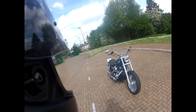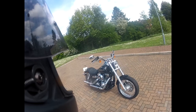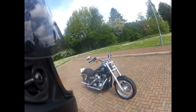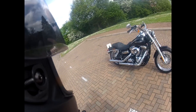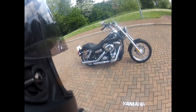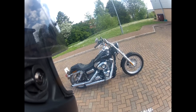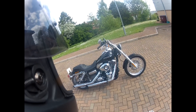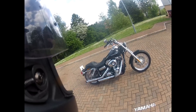The only mod I've done to it is to put those pullback risers on that you can see, which for me gave it a much more comfortable riding position. Unlike the Softails, you've got standard pegs. You can put forward pegs on — I don't know if you can see on the frame, there's a couple of little buttons just ahead of the exhaust. Those are for mounts if you want to move the controls forward. I quite like the controls where they are.